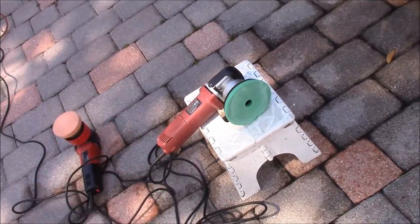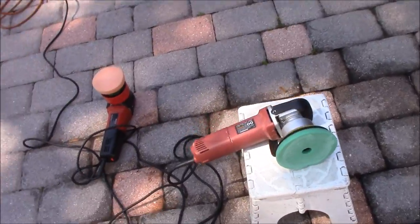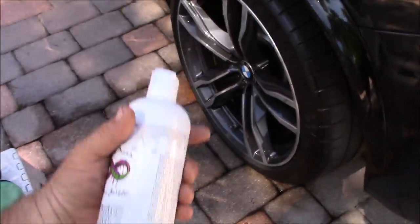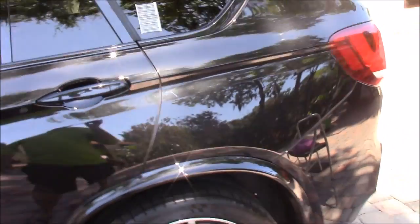With the green pad — that's their cutting pad — and then they've got their orange, their maroon, and then their red applicator pad. That did a really good job of minimizing the scratch; it got rid of the coarse edges that make it look white and chalky. So I'm happy with the result. That is Infinite Cut from detailjuice.com. I'll probably go ahead and hit that quarter panel with Infinite Finish — there's no compounding haze, Infinite Cut leaves an amazing finish. But I'll just hit it real quick with Infinite Finish, and then if he notices it in the sun looking far better than the rest of the panels I can possibly sell him a polishing job.